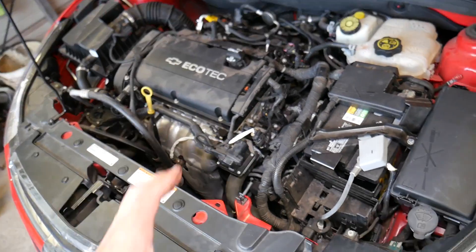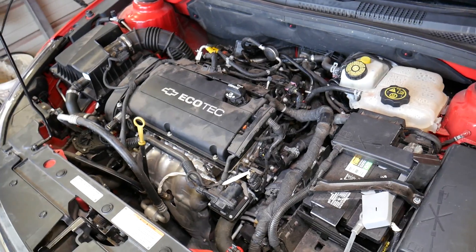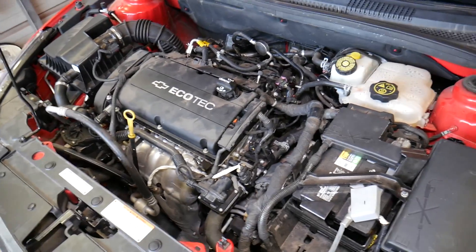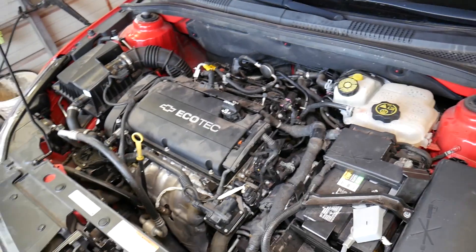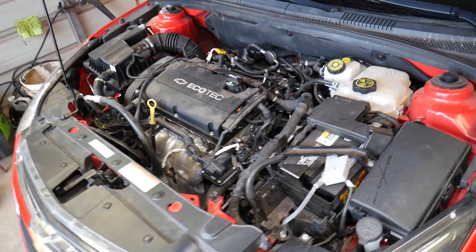When the car is running you will see bubbles. Now, first — if you recently drained your cooling system or flushed the radiator — it means you probably didn't bleed the cooling system correctly. But after a while, if you didn't overheat the car seriously, it should go away. If you bleed your cooling system the correct way, we have a video on the channel that explains how to do that.